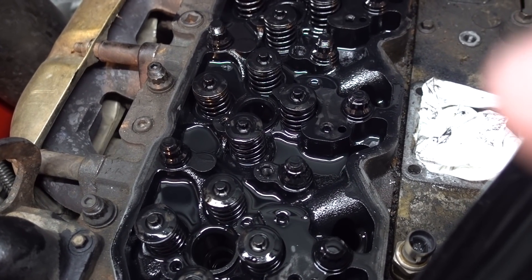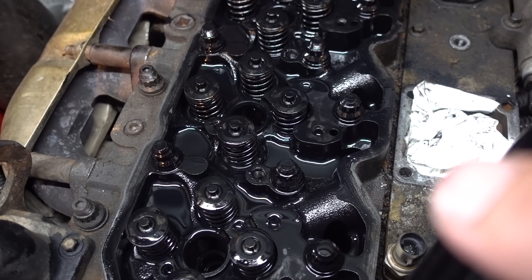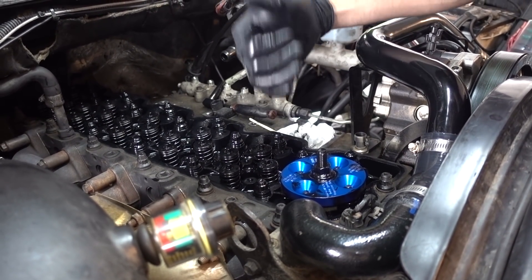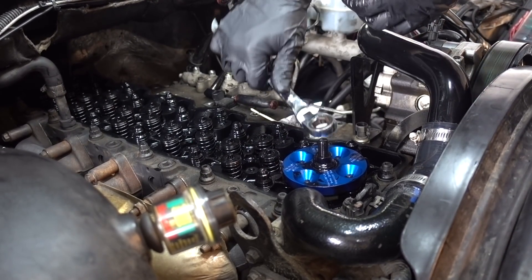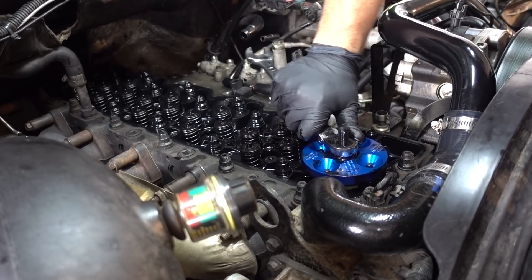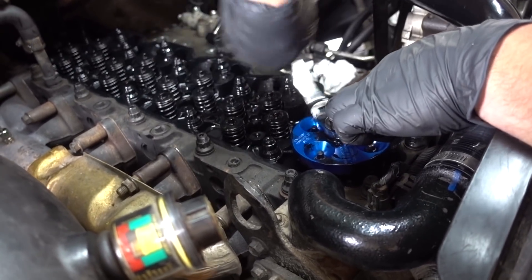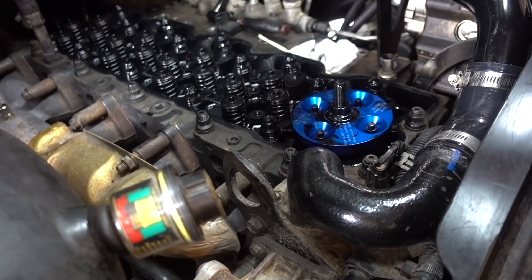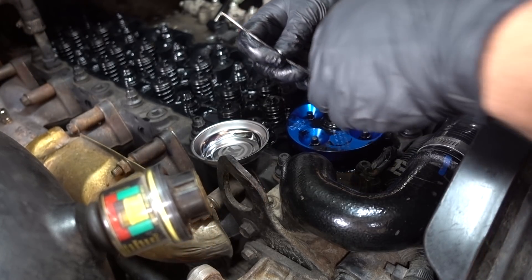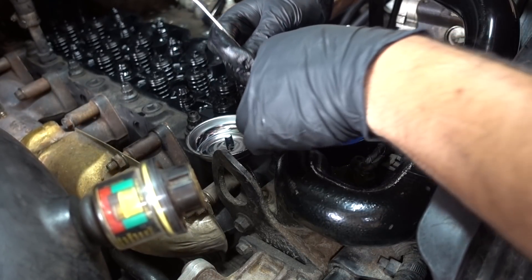We're gonna roll the engine over, get one of the pistons — usually number one — closest to the top of the cylinder bore, and then put my compressor tool in to compress the valves. The tool is a two-piece setup that screws into the injector holes, has a stud that sticks up, and then a plate slides over top. You spin this on and tighten it, and that actually compresses — you can actually hear them pop. Then you screw it down, and the top of the valves rest against the pistons inside. Then you need a little magnet to take the keepers out.